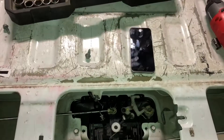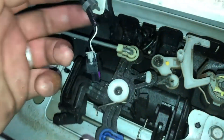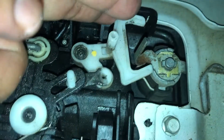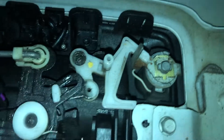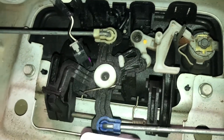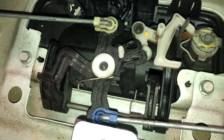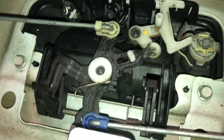After pulling this apart and looking at it again, still trying to figure out what the hell. Basically the way that little pop-lock solenoid works is it actuates this little lever right here. When this lever is in the up position, it does not allow the tailgate to open. But when it actuates in the downward position, it works just fine.